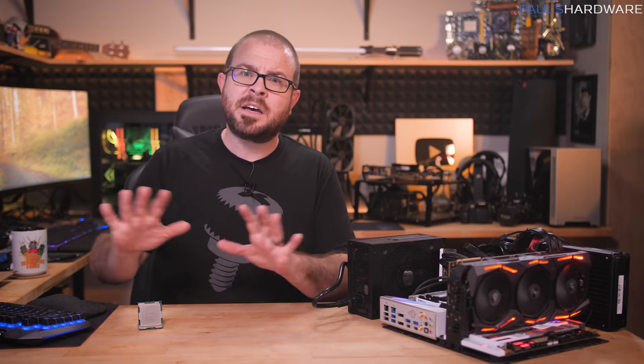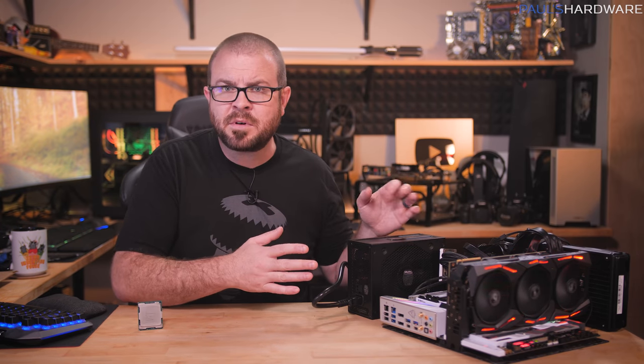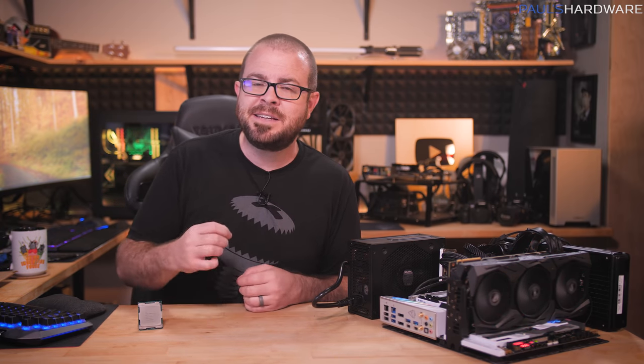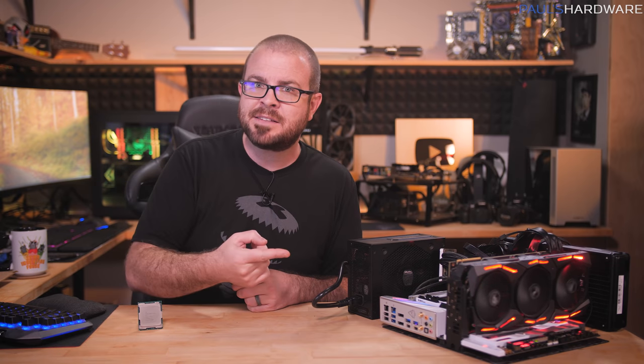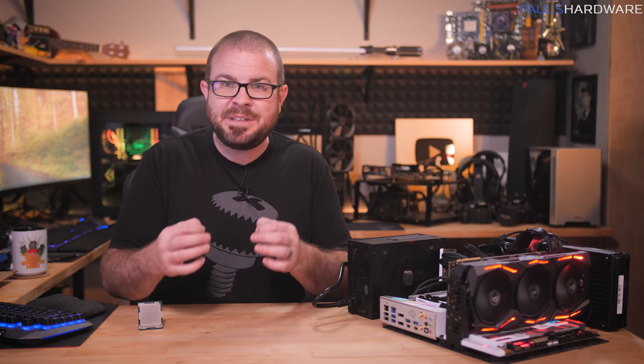These are high-end desktop CPUs, so bear in mind there's a difference between high-end desktop and mainstream. They're going to use higher-end, more expensive motherboards and feature quad-channel memory support, as well as a lot more I/O than mainstream platforms. Intel gives you 44 direct PCIe 3.0 lanes to their highest-end CPUs for connectivity, while AMD is giving you even more connectivity with 60 PCIe 4.0 lanes on the newest Threadripper 3 CPUs. And that's not even including the chipsets.